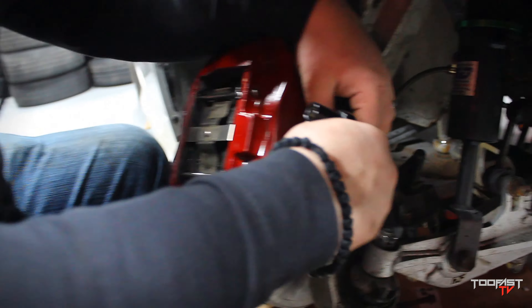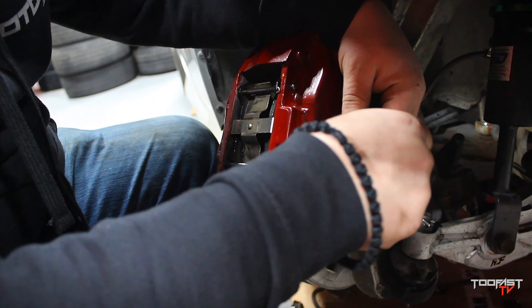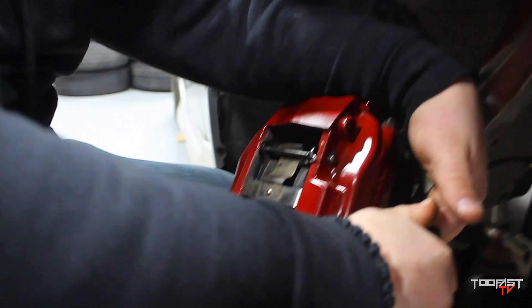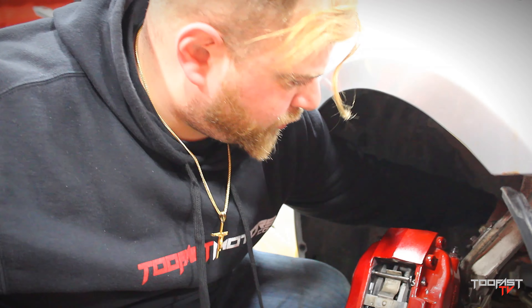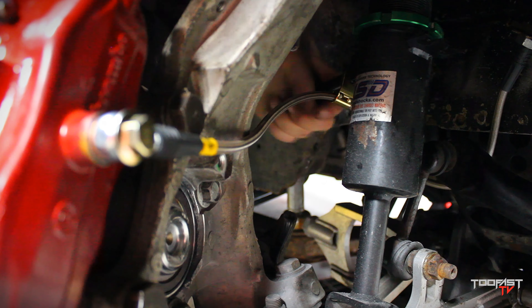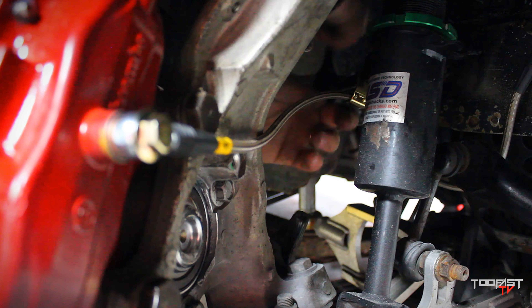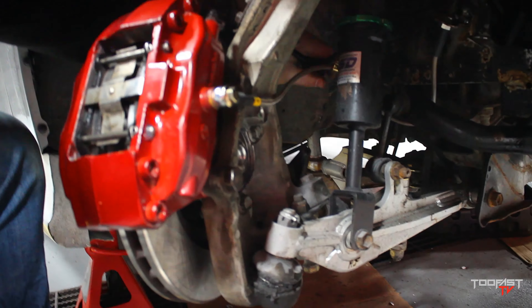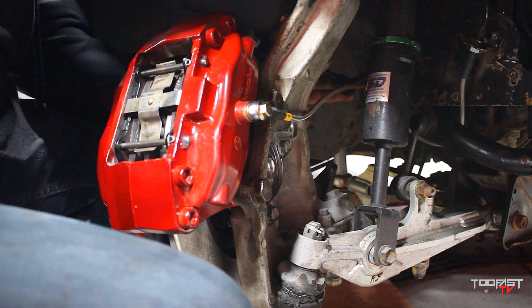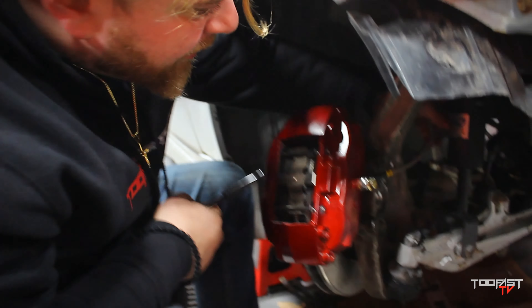Okay, that's good. There are two crush washers — one on the front, one on the back. Make sure you got both in there and go ahead and tighten that. Then what we'll end up doing is just tightening the one bracket on the shock itself — that is pretty much it for the brake line. It's a 12mm bolt on our HSD coilovers that we have in this car. That's a muscle build-up right there, boom. Okay, now we got that tight — I'll hold the camera; Sean, can you go pump the wheel left and right for me?